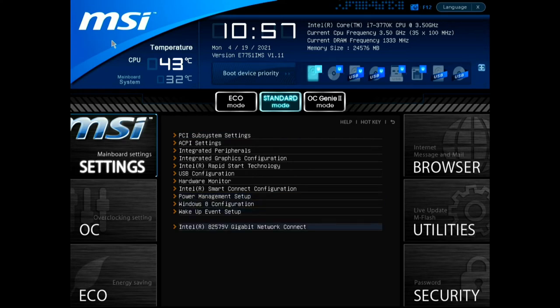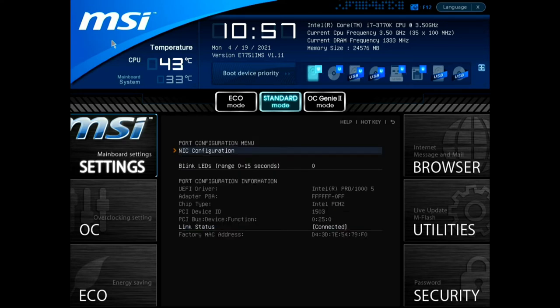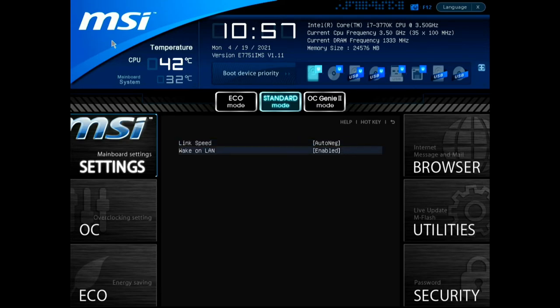While you're in the BIOS, take note of the MAC address. If you can't find your MAC address in the BIOS, don't worry — I'll show you another way to get it later. To test that Wake on LAN is active, I recommend switching on the machine and then switching it off. If the Ethernet port remains flashing — usually an intermittent flash; mine is orange — then Wake on LAN is most likely all set. However, some systems don't have any lights to indicate that Wake on LAN is functioning.